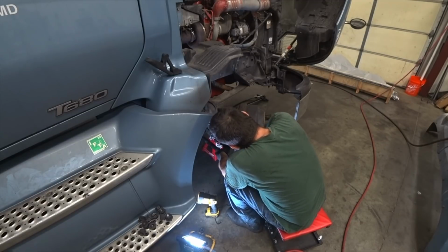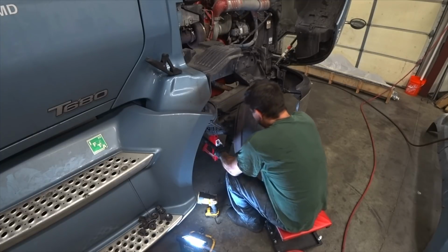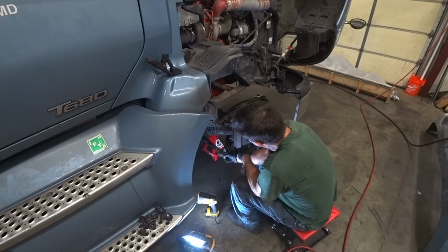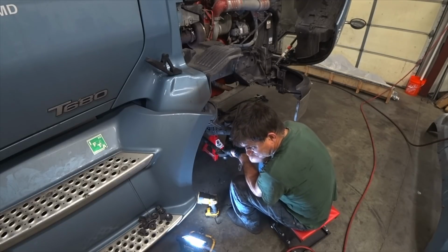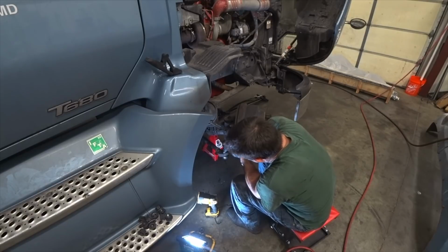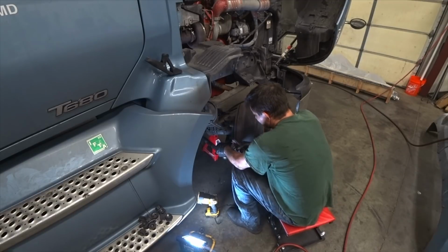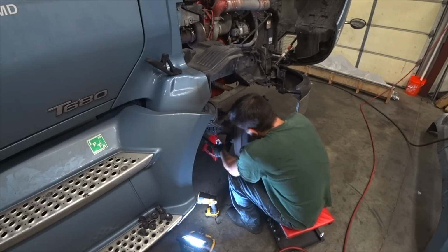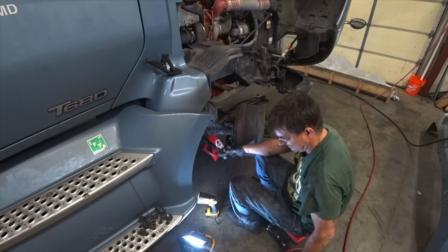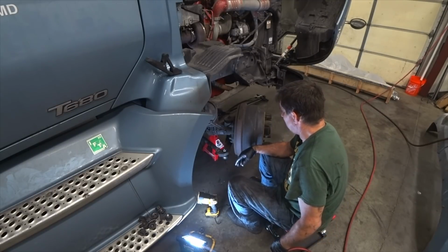And then I don't bend them over so that it's tight in there. I leave it sitting out so the head of this cotter pin is out here. I do that for a reason, because I take them apart. These that are on here, these are probably original, and they had the head sucked all the way in. Well, you couldn't grab it with a vice grips. So if you just put them in there just so you know they're a little bit, it doesn't have to be sucked in there tight. There's no reason for it. It's just in there so if the nut ever would come loose, it can't come off. That's all it is. That's all it's about.